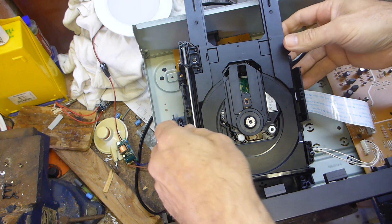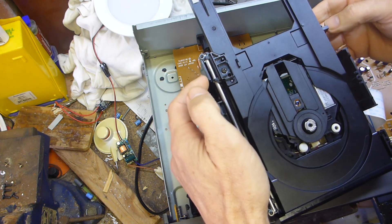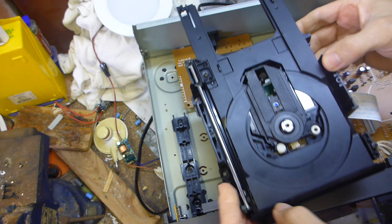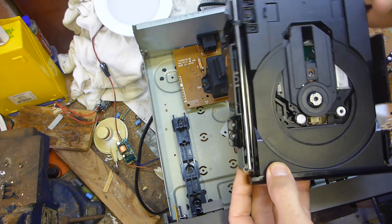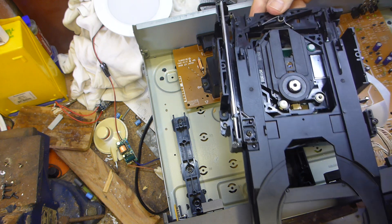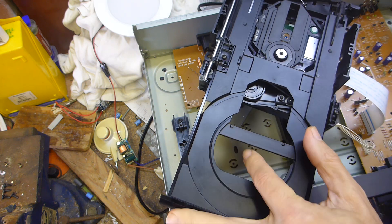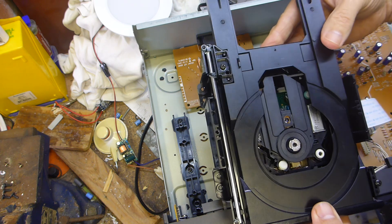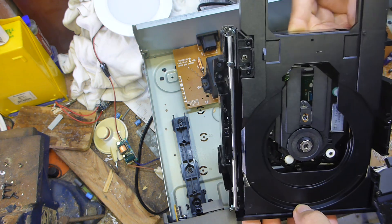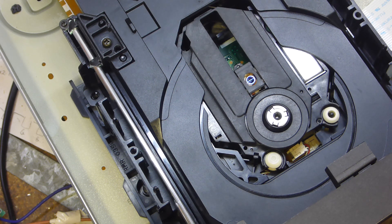So I've got everything back together. When trying to put this tray back, you'll find you can't do it because of plastic slider clips - particularly on this side. You can't put this mechanism back together in the closed position; you've got to put it back together when it's in the open position. Note the position of the slide-out tray drawer - it retracts to give the telescopic feature - that distance is closing, and then when it comes together that is the position you're looking for to put the tray back together.